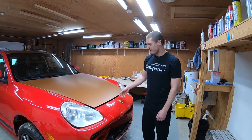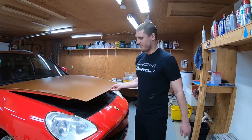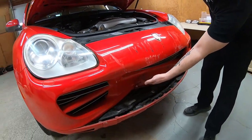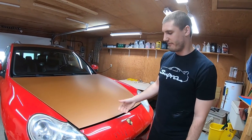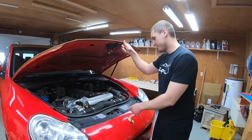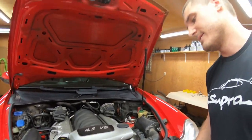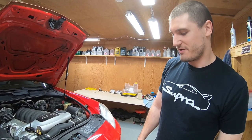The hood was down, and when my dad got back from the accident I popped it open just to see if there was any damage under there. There's surprisingly no leaks from the radiator, even though the damage goes pretty far in. I did notice that when the hood closes it does the first latch but no longer does the second latch. This part kind of looks like it was pushed back and is angled now.